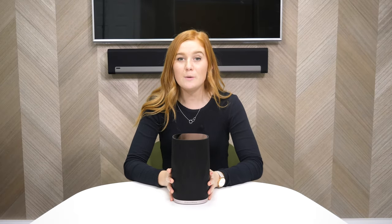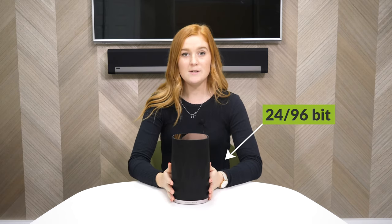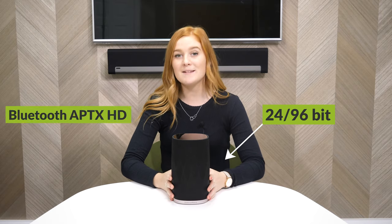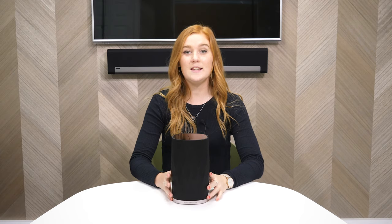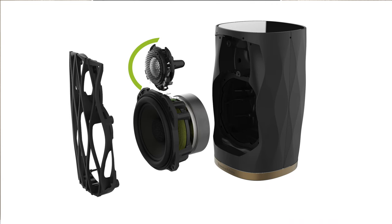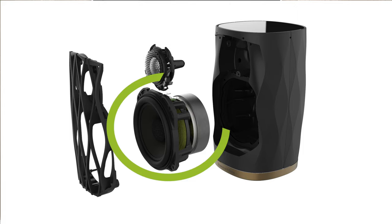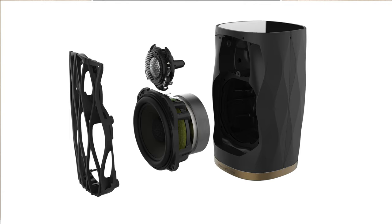The Flex is definitely one to consider for music streamers as it offers the highest quality of music streaming currently available — 24/96 bit — as well as the best standard of Bluetooth, Bluetooth aptX HD. Internally it has a decoupled dome tweeter taken from the Bowers & Wilkins 600 series, which helps to produce studio quality vocal clarity. It also has a 4-inch woven glass fibre cone which helps ensure rich bass and mid-range, and each of those drivers has a 50-watt power amp using DSP, totalling 100 watts — which is massive for a speaker of this size.